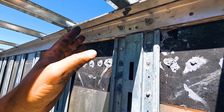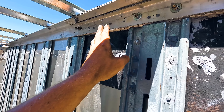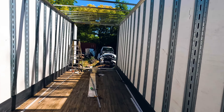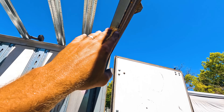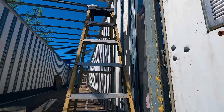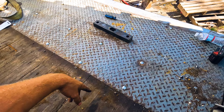The inside won't be pretty but we have covers that go on there and will cover everything up. This was kind of a pain in the butt — it seemed fast because of the fast-forwarding, but I really need to get this done. I'm sorry, this is my first time rebuilding a trailer and I have no clue what I'm doing. We stitched it up by adding supports: one on the back, one connecting the two pieces, and one on top, all bolted together with rivets and bolts. Everything gets covered by the planks.